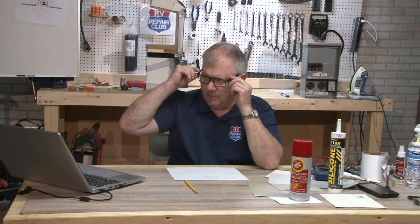Bill Austin said, battery upgrade, replace with wet acid, glass, or lithium. So there are the standard in-house batteries, and we're looking for deep cycle batteries because they're going to be drained and replenished many, many times, called cycles. The standard is lead acid batteries, and they work just fine. It's just that they take a little more maintenance.